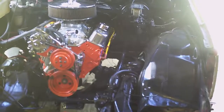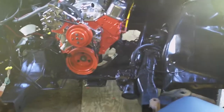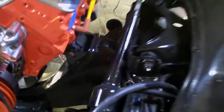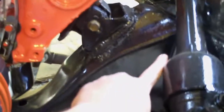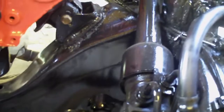I'm waiting on the headers to get here — I'm going to get full tube headers to put on it. I just wanted to show you guys this in case anybody wants to do a future V6 to V8 swap. Make sure you do it just like I did here and you won't have any problems in the future changing mounts or having to cut holes. What I mean by cutting holes is people would cut big slots in the frame right here to get to the bolts on the back side of this bracket, and I don't like doing that. I'd much rather weld into the frame than cut into it.